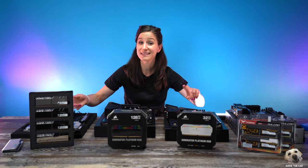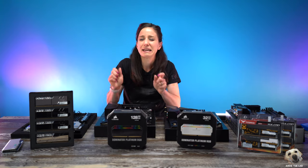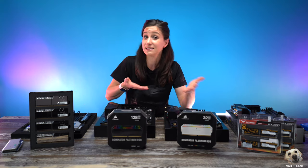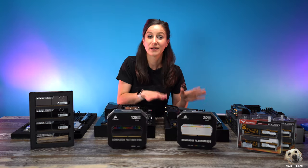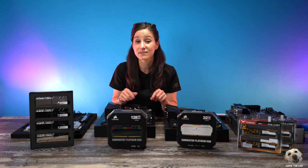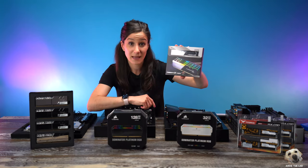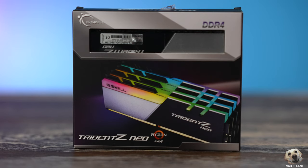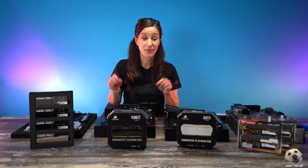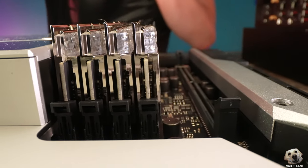The last thing we're going to install before we get to the giveaway build is the RAM. Unless you're doing crazy overclocking or trying to squeeze out every last bit of performance, most RAM today is pretty decent and you can kind of buy it based on aesthetics and price point. DDR4 is the most current generation; DDR5 is coming shortly, which I'm excited about. The only thing is that AMD is a bit more sensitive to RAM timing, so if you're doing an AMD build you need to make sure the RAM is compatible. For example, on the outside of this Trident Z Neo box you'll see Ryzen AMD, so you know it will work. We are going to be installing four sticks on each motherboard — the slot you put the RAM in is called a DIMM slot, and the extra NVMe we installed will go right next to the RAM in a DIMM.2 slot.